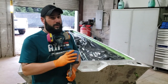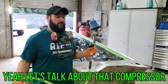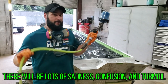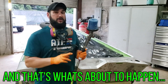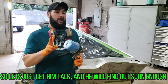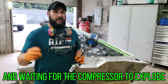I'm not really worried about the heat because One Hit Wonder paint - I've tested this down into the low 40s. The lowest I've ever sprayed was 42 degrees and it still dried just fine. I just drained the compressor and got about two gallons of water out of the bottom of it, so I'm running two inline desiccant filters - one on the line and another one on my gun - and I'll be changing those out between coats so I'm not getting any contaminants inside my spray gun. The color we're spraying today is bright blue. We'll spray at least two coats and then go back over everything with a matte clear.